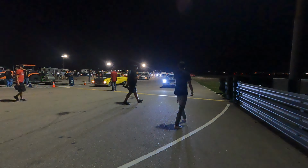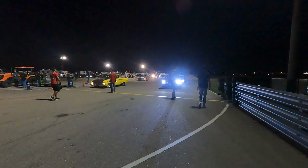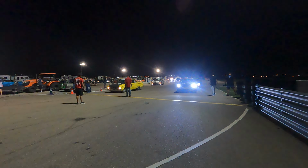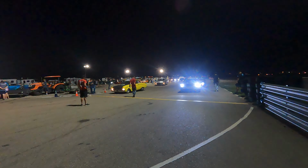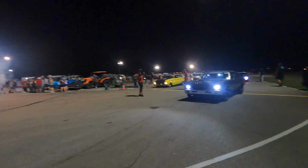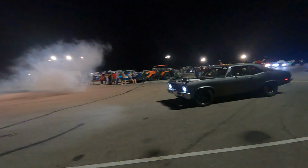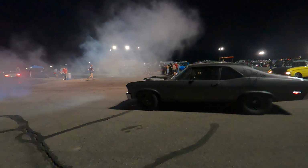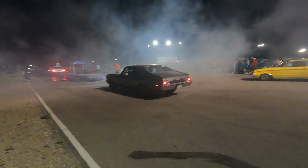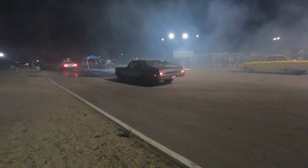And then on top of it, we were going to need to get at least a 160 amp alternator, which is about the highest amperage that you can get off the shelf. And there was no guarantee that that was going to get this car running down the strip properly. We were looking at all kinds of different solutions, and it was going to be throwing money at the car without getting the output that we needed to actually complete this event.